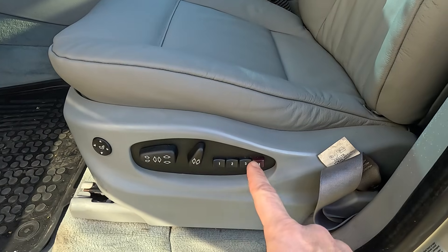This battery disconnection trick is easy to do, but it has one downside: your car will forget all saved settings, such as preset seat positions or stereo settings, and you'll have to redo them after reconnecting the battery. Also, if your head unit has a code, make sure to have it, as you'll have to enter it after the reset is done.